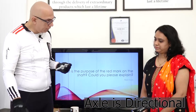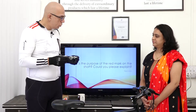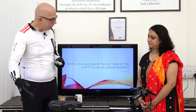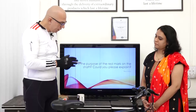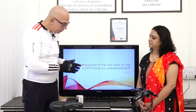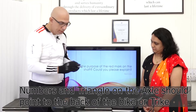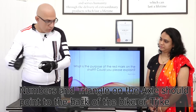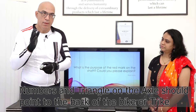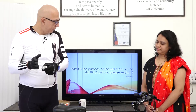So that's what we did here in the wheel — we installed it so that this is on the drive side. We have a drive side and a brake side. On the drive side, we want to make sure that this part — this number, red — is pointing to the back. That allows our torque sensor to work correctly.